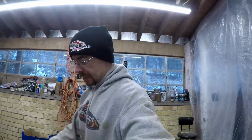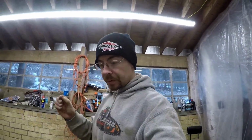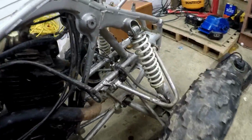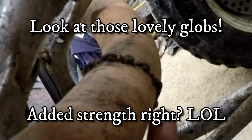Again, as I figured would be the case, it's one of those things where once I dig in, you start finding more and more little things. Here you can see the muffler a little bit better, and you can see how it's just kind of pipe clamped up there and it's loose. I don't know if they weren't able to get the bolts off of the header piece there, and so they didn't press their luck. There is a weld right here, so that tells me that this has been cut and welded back on for some reason. I'm guessing it's probably because of the bolts there.